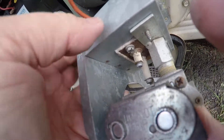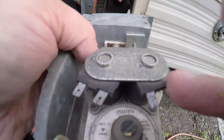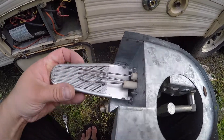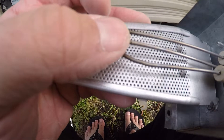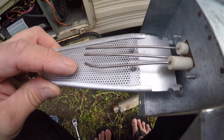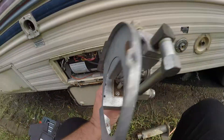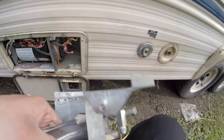The red and orange are your igniter wires, and the red and yellow are for your gas shutoff coil valves. This is the igniter — as you can see the tips are kind of worn. I just put a new burner in it while we were camping; there was a big hole in the other one. That's a wearable item and it's literally just two screws to replace.